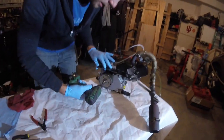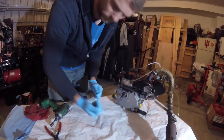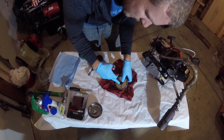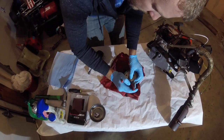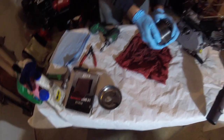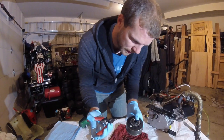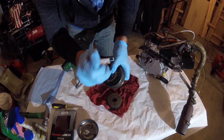Let's go ahead and get started. We'll take this off. Grab your snap ring pliers and you're going to take off this snap ring right here. You're going to want to take care to put your thumb kind of on it, just so it doesn't go shooting off. Sometimes it takes two tries. Grab it. Take your key so you don't lose it. Then pull this apart. Once you pull this off, you're going to grab your snap ring pliers again, take it to the sprocket side, and make sure you keep your thumb on there so the snap ring doesn't go shooting off.